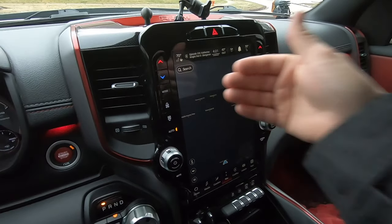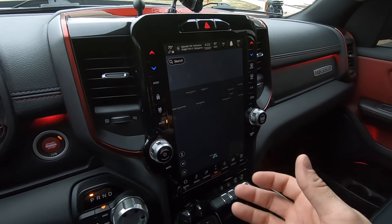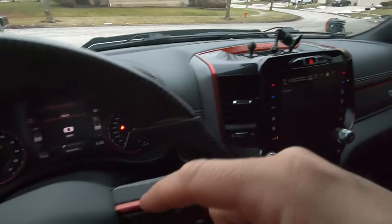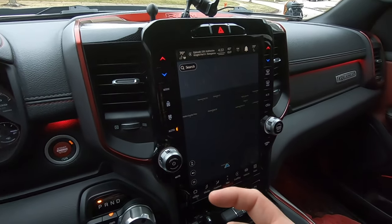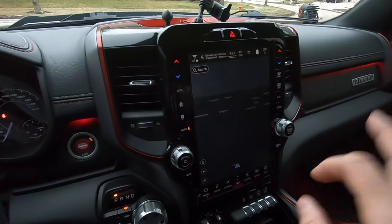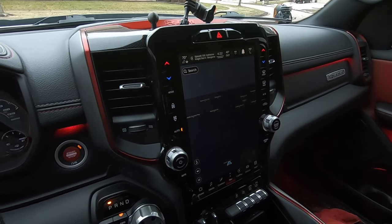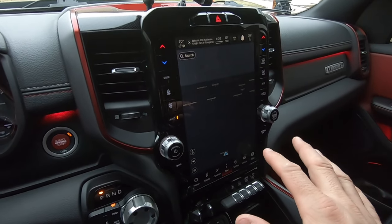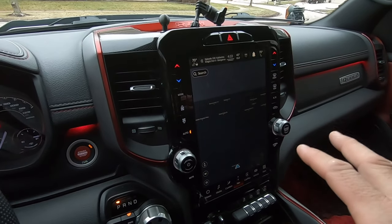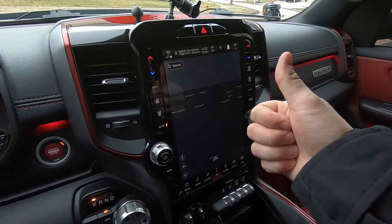The process is very simple: pull out your factory radio, unplug everything, put in the three or four retrofit harnesses, plug in the new module, plug the module into the new screen, slide everything up into place, push your programming into the truck using the OBD port and security bypass, perform a sleep cycle on your BCM, then fire up everything and verify it all works. If you have any questions, leave them in the comments or reach out to infotainment.com — one of the best customer service lines I've ever dealt with; they got back to me almost instantly within the hour. Hope you enjoyed this one — like, comment, subscribe, and thank you very much for watching.